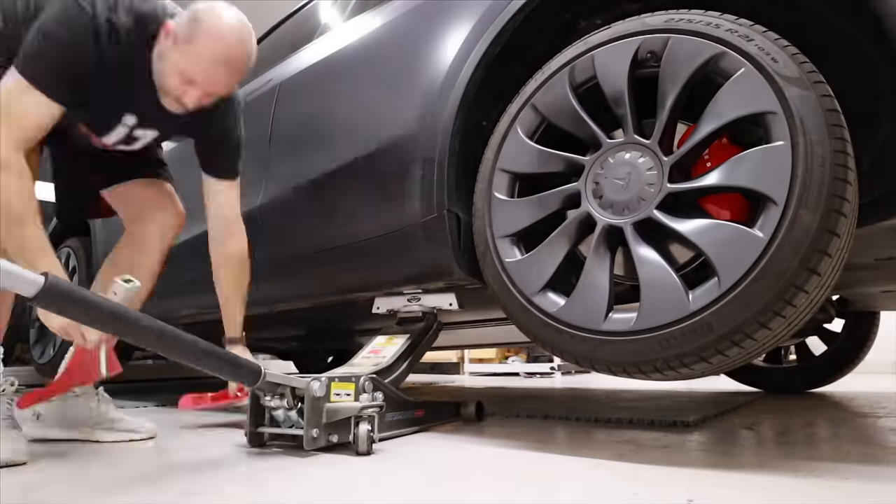This trailer hitch is from Torque Lift - I got mine from Teslarati and there is a link below. It's a pre-order for less than $300, and you can actually get the jack stands and the hitch for less than what Tesla charges for just the hitch alone. Thanks for watching. The hardest part was that stripped bolt and the tail light bolts, which are trickier to get to than on the Model 3. The rest is not that hard. I put everything back together in half an hour. I'd say you can get this whole project done within an hour to three hours in your driveway or garage. Jack stands make it easier but aren't strictly necessary. Stay awesome, stay positive, and I'll catch you on the next one.